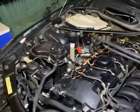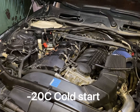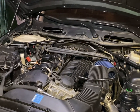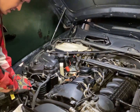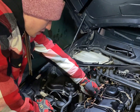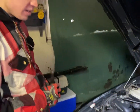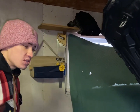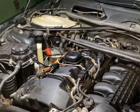Now we'll see if that fixes it. We've ruled out the misfire — that's great. Now we're actually going to swap out all the plugs and coil packs just to be safe, because this is pretty common for these cars. It's running a stage one tune, so it was expected to happen at some point. Glad it didn't leave me stranded.